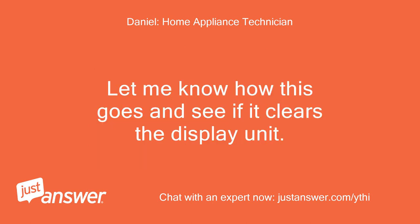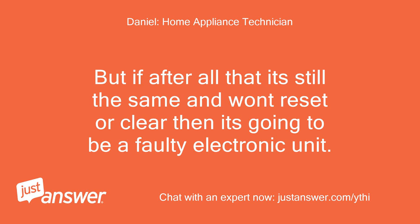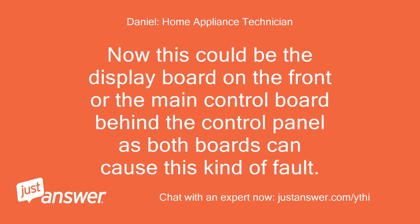Let me know how this goes and see if it clears the display unit. But if after all that it's still the same and won't reset or clear, then it's going to be a faulty electronic unit. Now this could be the display board on the front or the main control board behind the control panel, as both boards can cause this kind of fault.